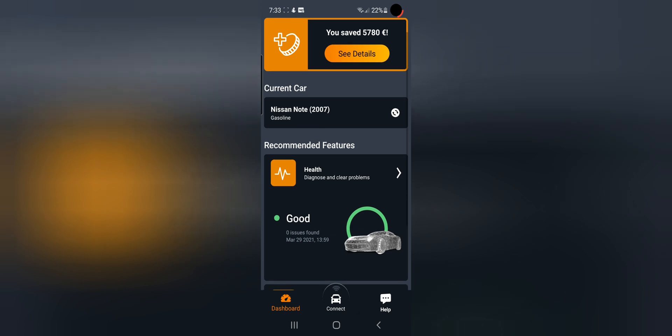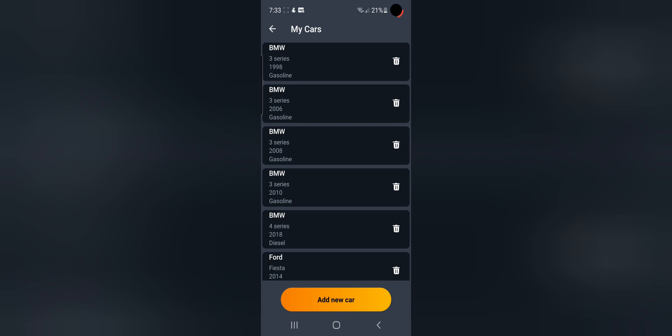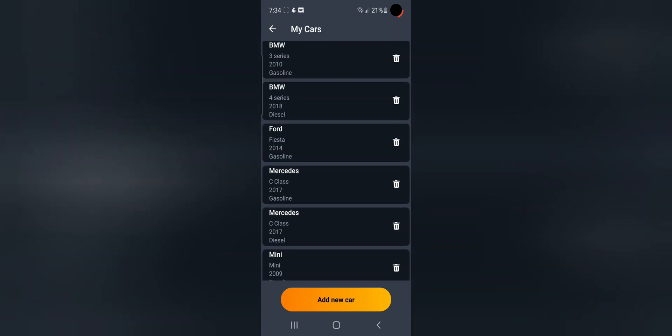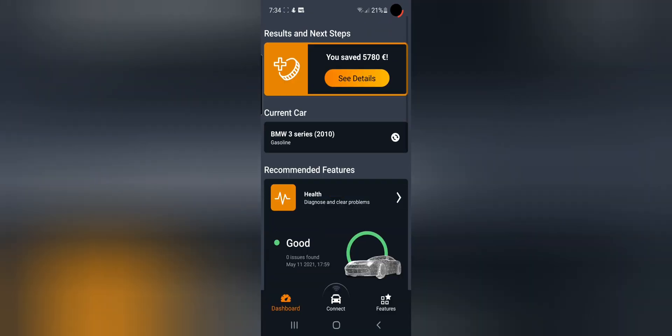If you're looking to get a Carly to open a little coding business, be very, very careful. Coding this BMW caused so many headaches and problems - one window not working, then the other window not working, then the boot immobilizing. You've got to check everything. The only car I had a problem with was the BMW E93 convertible - the 3 Series convertible - I had nothing but headaches with it. Everything else was fine.